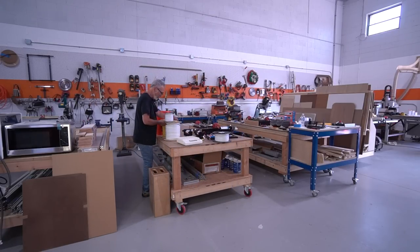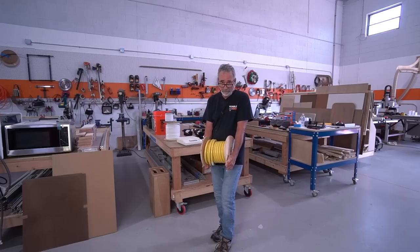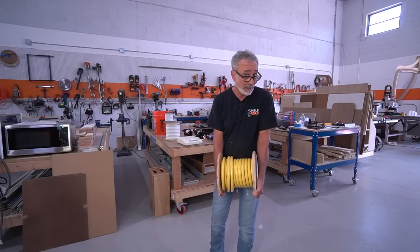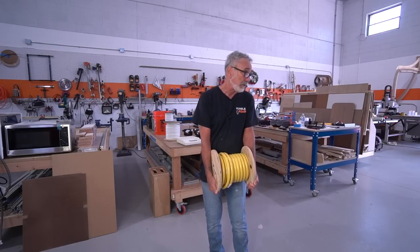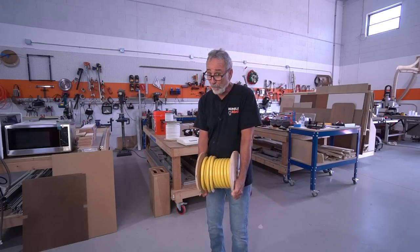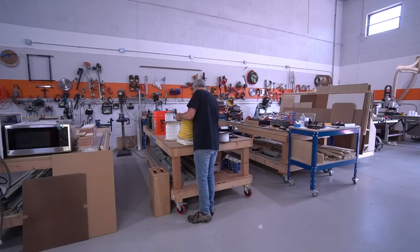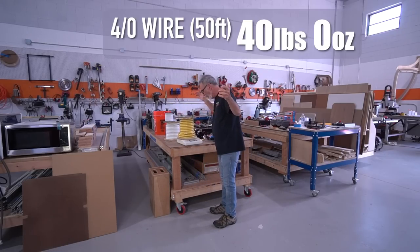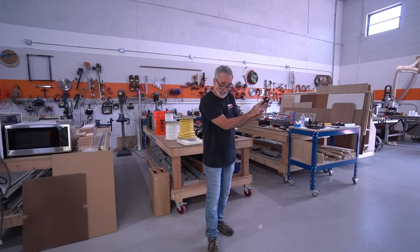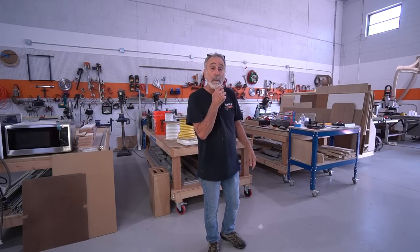This is a biggie — one of my favorite wires to work with. This is 4-aught cable. 4-aught is what you need to get from your battery to your bus bar, from your bus bar to your inverter, and from your alternator to your bus bar. The alternator is up front and your bus bar is typically in the back, so you're looking at 20 feet for a positive, 20 feet for a negative. This is a 50-foot roll, pretty much all the wire you'd put in — 40 pounds. So the wires you run from your alternator back to the bus bar, a very common run in any van build, come in at 40 pounds of wire.